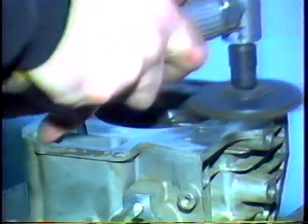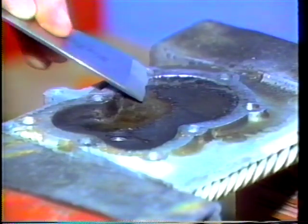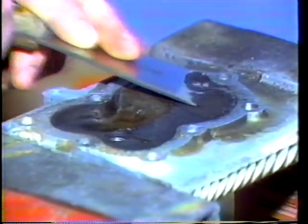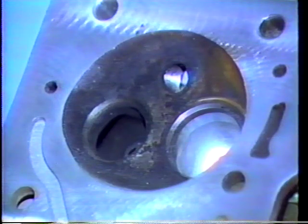The cylinder heads should be cleaned as just described for the cylinder block and crankcase cover. Carefully use an abrasive pad on the cylinder head gasket surface without damaging it. Use a scraper to remove any heavy carbon deposits inside the combustion chamber. After scraping, remove any remaining carbon with a wire brush mounted in a drill.